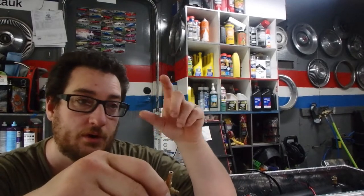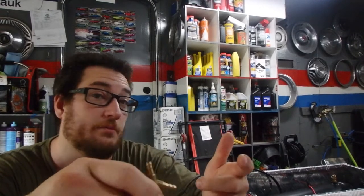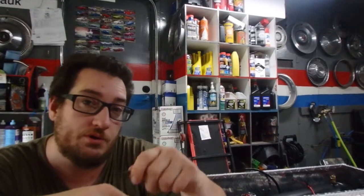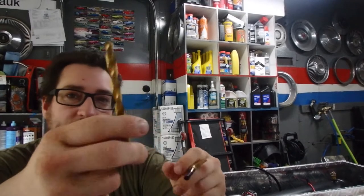What is under a quarter? And I go, well, let me try 3/16. Of course, one thing I realized later on, which you might do in your own life, if you're having trouble trying to figure out the inside diameter of a hose, grab a set of drill bits. So this one right here, for an example, says 5/16 on it.